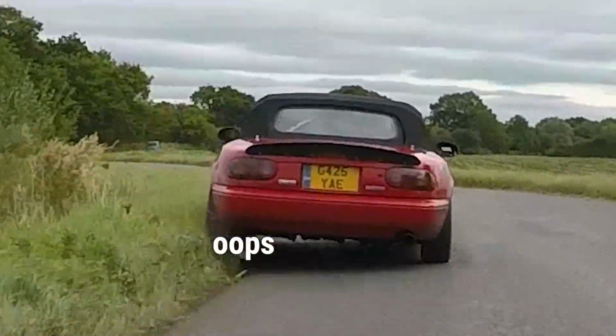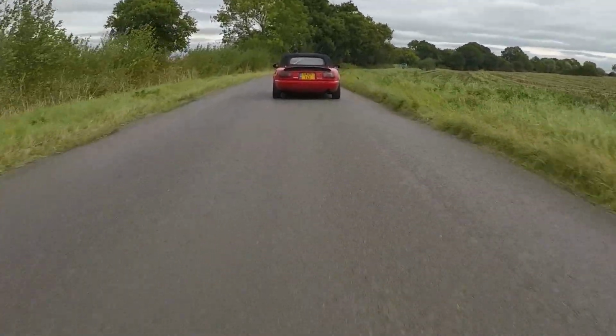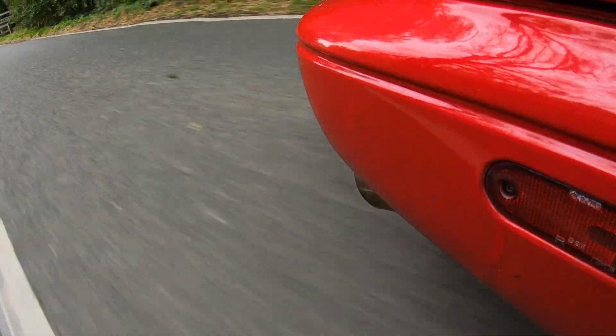Driving Jake's car is pretty interesting. It started out life as a 1989 1.6 automatic, which we picked up from Cornwall. We then immediately ripped out that engine, fitted a 1.8 VVT, mated it to a 5-speed box, and added a Torsen differential. The whole thing is controlled by an ME442, and it made 142 horsepower on our dyno, which we think is really, really good. Until you find out that actually, when it was dynoed, both the exhaust cam and the intake cam were retarded a whole tooth, which means there is still power left on the table for this thing, which is amazing.